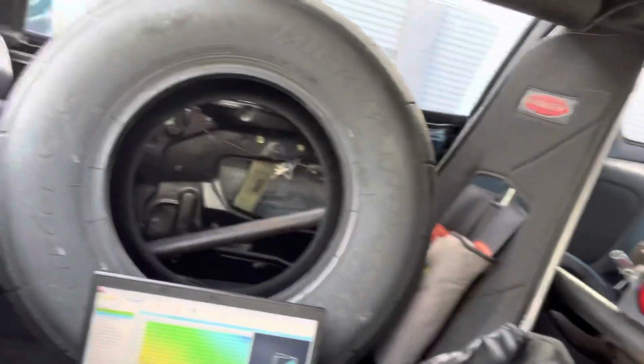So I decided to go to the storage unit, pick up some tires. Gotta swap out the front tires. The bias ply tires are a little too short for all-wheel drive driving around. Fine under load because they kind of lift up and can be tall enough, but just cruising around, they're too short and the transfer case binds up basically. It sounds awful. So taking these tires to Dubois County Tire and get them swapped and try that. Should be good because these have enough support that they won't smash down, even aired down. So that's planned.